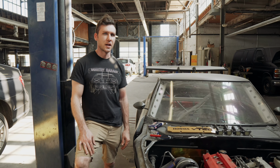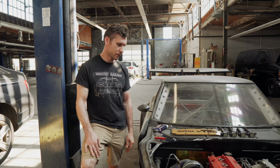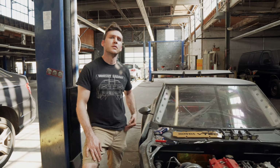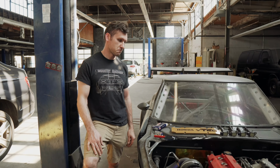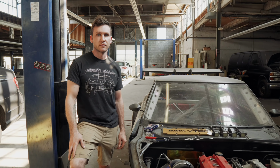Oh really? Yeah, some people, I was confused when I did mine. If you're doing synthetic, I would probably stick with synthetic even for a break-in. Well, for break-in you don't want synthetic because it's too lubed. When you've got a freshly built engine, really? You want it to wear in a little bit. So some people do break-in oil, but I was researching, you could get away with conventional oil.